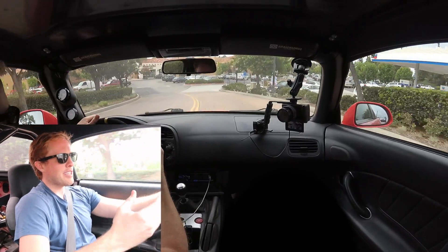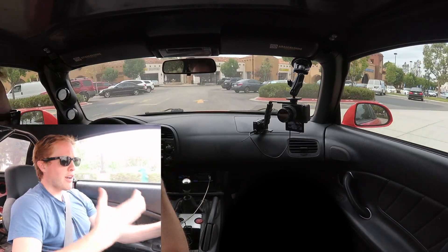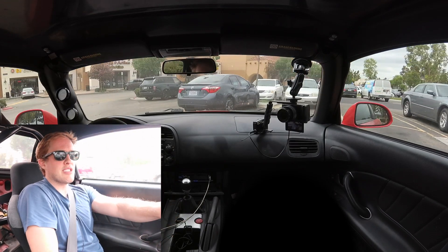So if your pedal is mushy, I would get in there, maybe tap your brake calipers with a hammer, and follow Stop Tech's bleeding procedure. That bleeding procedure involves two nipples — you want to bleed the inside nipple and then the outside nipple, inside first and outside after. That's because you've got four pots in the caliper.